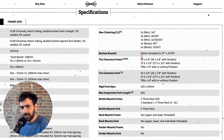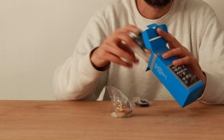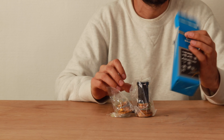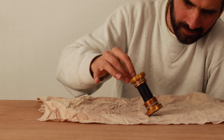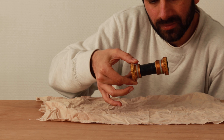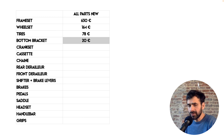These tires have excellent reviews and the price was 78 euros for the pair. The bottom bracket compatibility for the Bridge Club is 73mm threaded, so I got this mountain bike Shimano Saint which works for both 68 and 73mm bottom brackets and is compatible with Shimano HollowTech 2, which is the current standard for Shimano cranksets. The price was 20 euros.